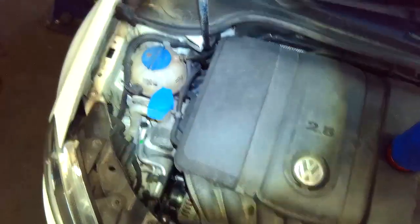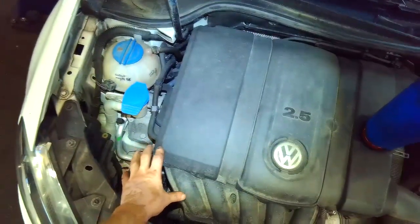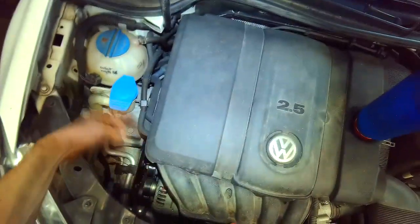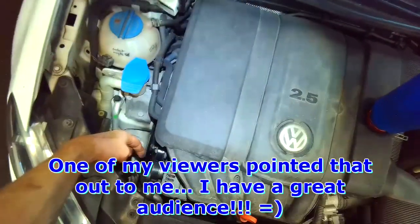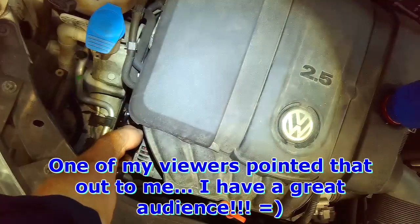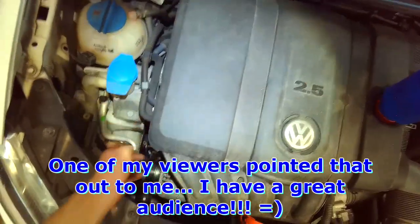This one is free. If you have a power steering reservoir, then you have a power steering pump up here, in which case your alternator will turn in the opposite direction. So your one-way clutch, instead of checking in the forward rotation, you would push it in the reverse rotation.